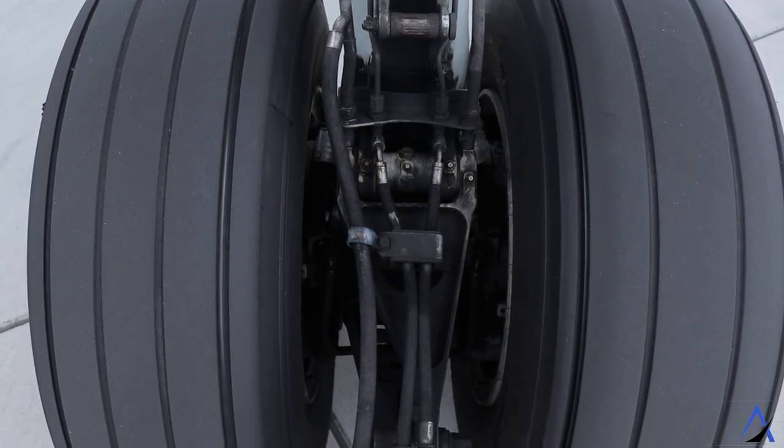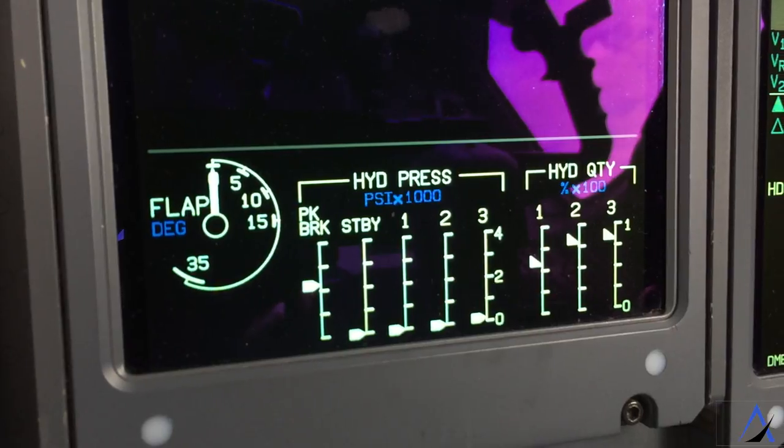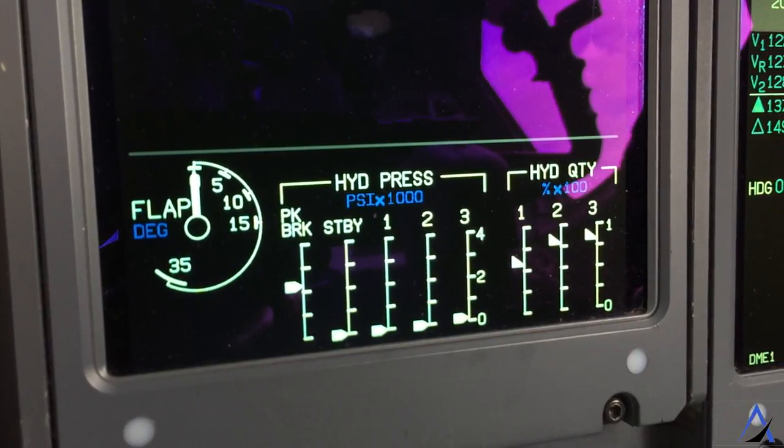Maintenance keeps track of all this, but it's our job as pilots to double-check everything and make sure nothing is missed — it's easier to deal with this on the ground than having to deal with an emergency in the air. Lastly, we check the condition of the hydraulic lines. The brakes on a Q400 are actuated hydraulically when we step on the brake pedals in the flight deck. We visually check the condition of these hydraulic lines for any leaks. If there are leaks, they have to get fixed immediately — otherwise the airplane is not going anywhere. We also have a hydraulic indication in the flight deck so if a leak develops in the air, we will know about it.